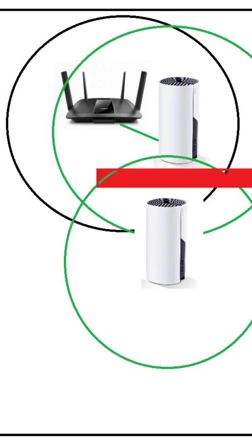What happens if there's a wall in between? You can position the nodes around to get around that, but this is where the P9 comes into its own — because the P9 can use power lines. You can plug a powerline socket into one socket in your house and then somewhere else on the same circuit. The powerline system uses the internal electrical wire as a network, sending data along that wire to another powerline at the other end. So you can plug one in either side of the wall and, using your electrical system, get through that wall and send the signal to the next node. The signals between the two nodes are what they call backhaul — basically the connection between the two nodes.